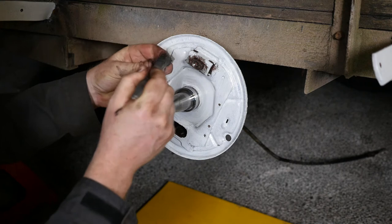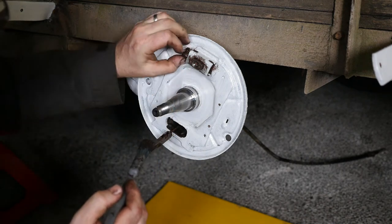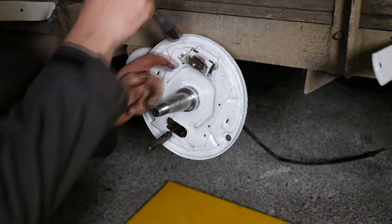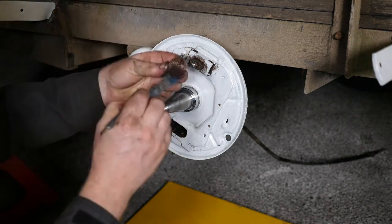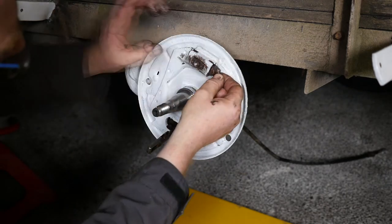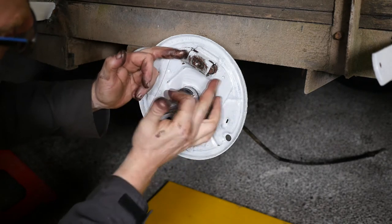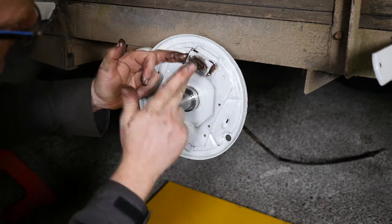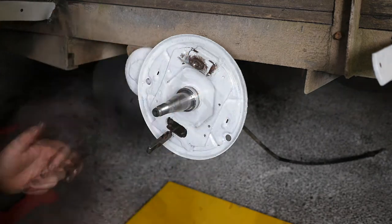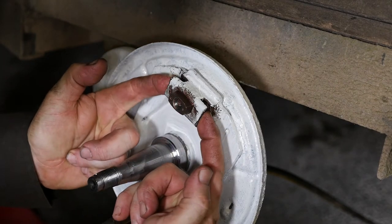Because of the condition of the hub I was somewhat over-worried about these wedges actually sliding as they're supposed to. I'm making sure the wedges won't seize up, but I will now have to redo that bolt, remove the grease from it, and put thread lock on, which is what's supposed to be there.